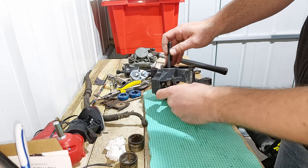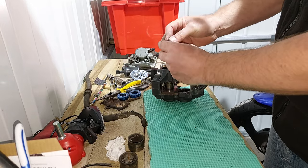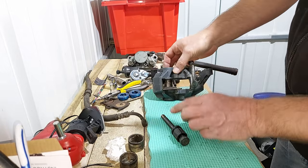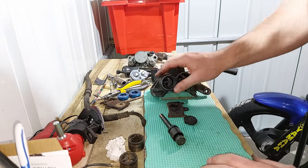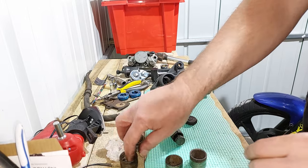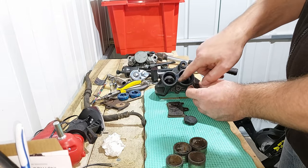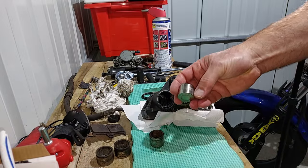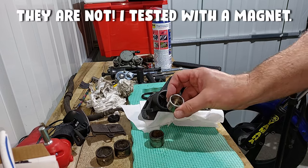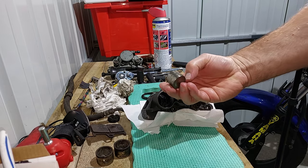Learn from my mistakes - pop the old pad under there so the piston doesn't go back in the hole. Pop a little bit of foam on there so it doesn't get damaged, tap it down, and there we go - it drops out. So we've got two small ones, two big ones, and it's completely clear now. I just need to take the seals out and give it a good cleanup. This piston here has cleaned up pretty well - they say these are stainless steel.